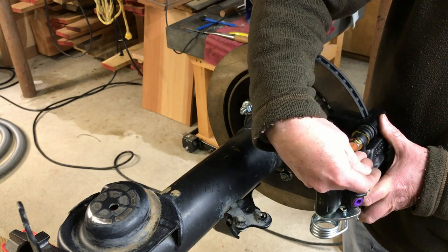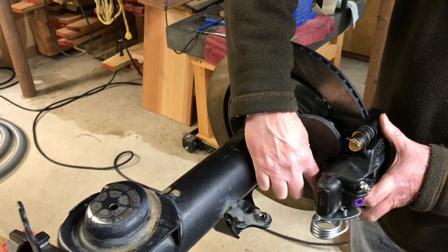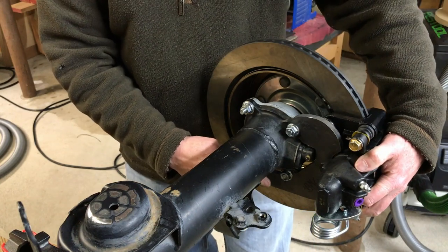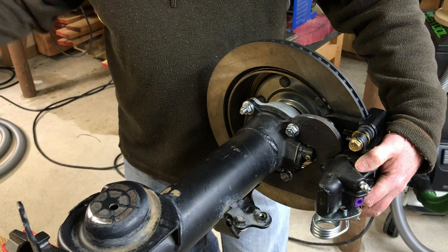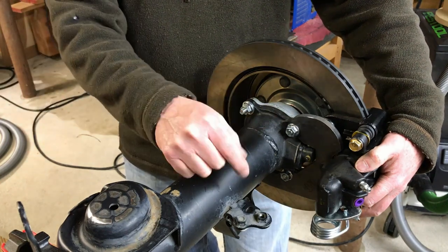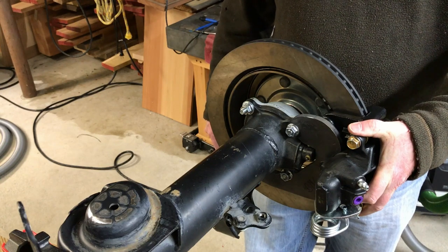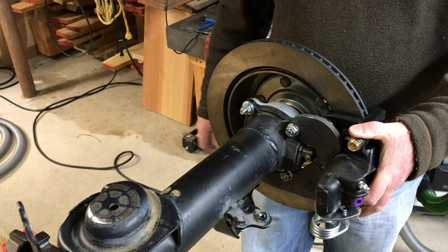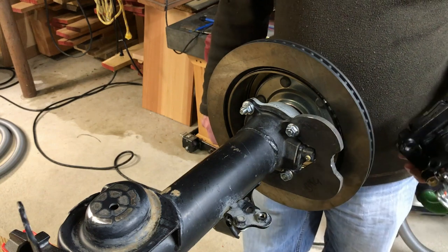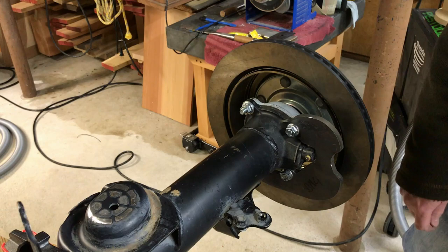Part of the reason I mounted the caliper on the back side down here: number one, you want the bleed screw to be up on top. Number two, there's actually a mounting point for the Ford brake cables that go through there, which should go right underneath the axle and be able to go right up the lower control arms on top. Hopefully I can run a cable from each side and not have to have a 90-degree bend. I'll shoot a video once I get to that point. With some double-sided tape it was really easy to locate those bolts, and you want them to be right on because the tolerances need to be pretty close — you don't have a whole lot of room with the pads.